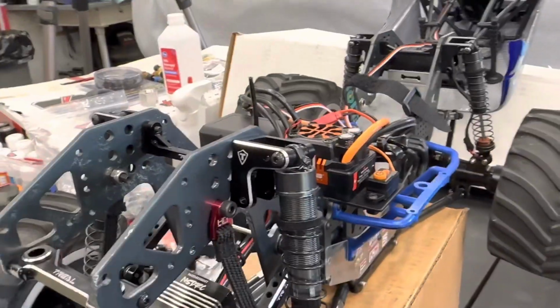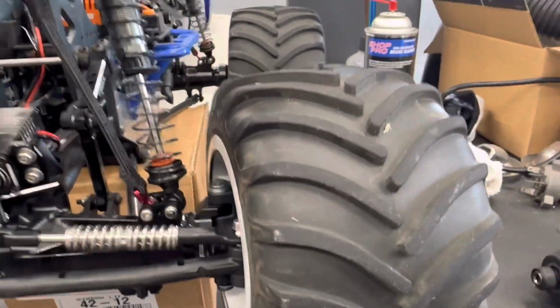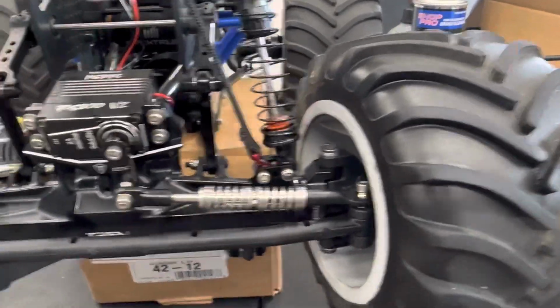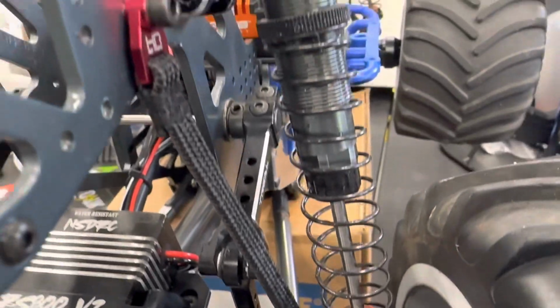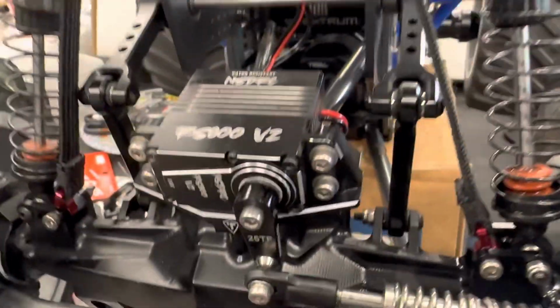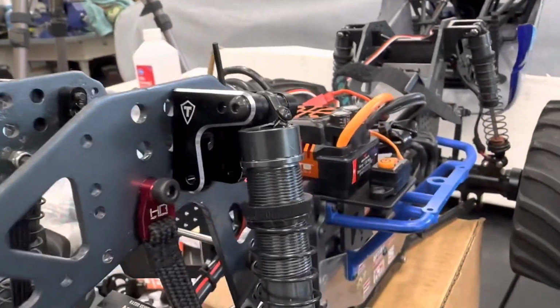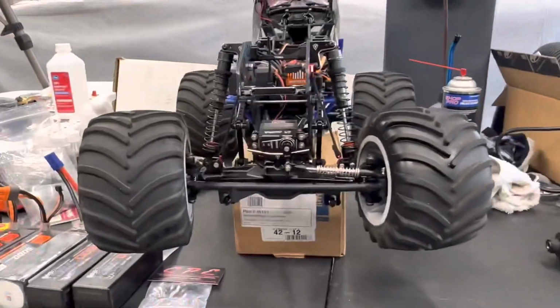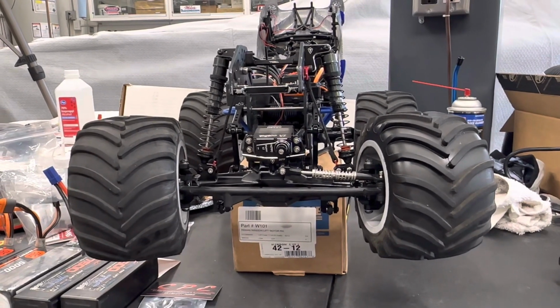There's oil everywhere. I was like, man, why is there oil all over the tire? What's all that? And look down, it's all nice and shiny down there. There's oil all over the shock, oil on the servo on this side, the whole axle, because that shock cap is done. So I ordered up a new shock cap,